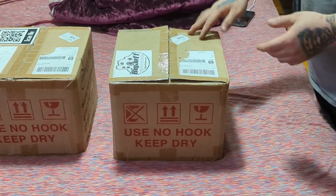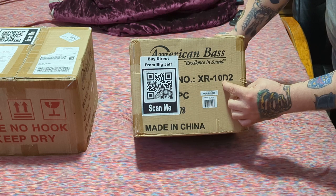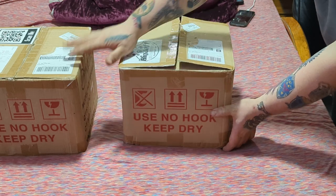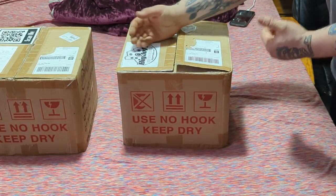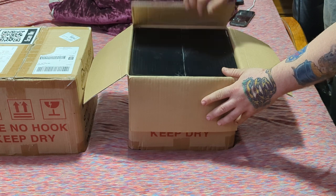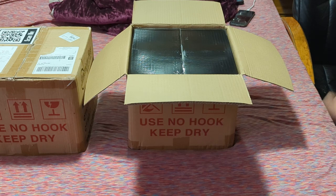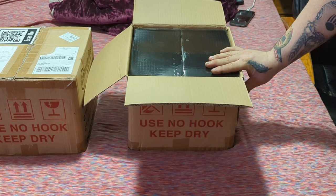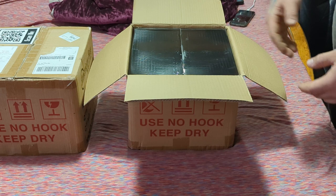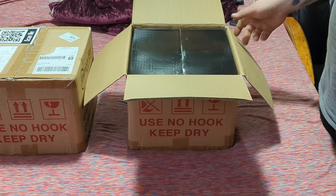Back at it again with some American Bass XR D2, or XR10 D2s — we got a pair of D2s. We're gonna wire them at half ohm on a VFL Comp 2K. It's replacing the XDs, which actually sounded really great with no issues. I simply upgraded the amplifier and it said the XRs were the recommended pair. I wired at half ohm because everyone complains the VFL Comp 2K doesn't make 2K — you're only gonna get there if you wire it to half ohm.